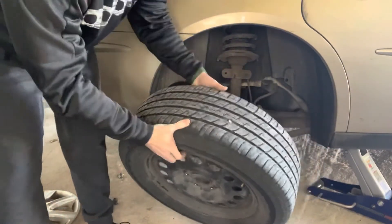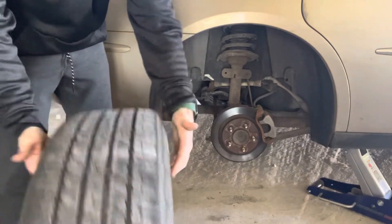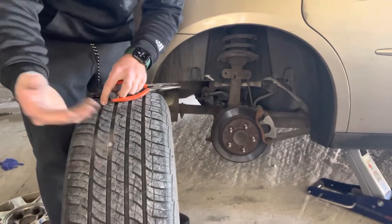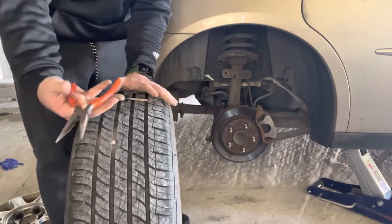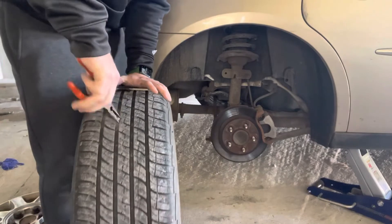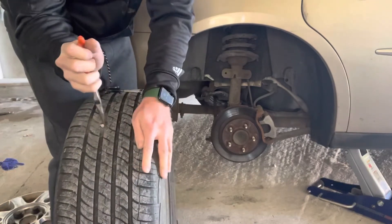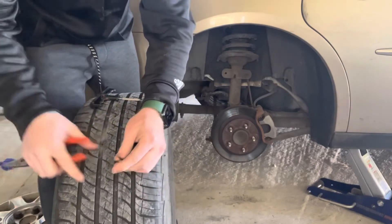So the wheel's off and you can see it rolled back right here — that's where the nail is going to be. You can look elsewhere on the tire to see if you have anything else, but it's pretty easy to tell that's where I need to fix. This doesn't need to be rushed. You don't want all the air to get out of your tire, but you don't have to make this the fastest thing possible. Just have your stuff ready. I have my reamer ready and a pair of needle nose. I had to get a bigger pair of pliers — there we go. That's all it was, you guys can hear it.